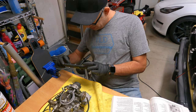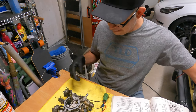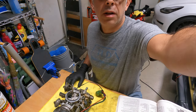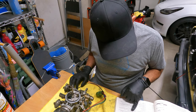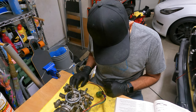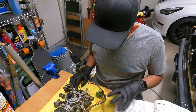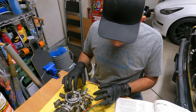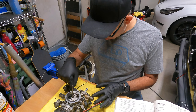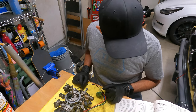I like to take pictures of everything so I can see where everything goes back together if I screw something up. Reading the manual here — interesting part: it says the carburetor should not be dismantled unnecessarily; removal of the air horn to clean out the float chamber is usually sufficient and can be done without removing the unit from the manifold. Too late, I already did that. But it looks like I can just take these main parts off to get to the float, check that it's clean, and access the jets as well once I get this off.